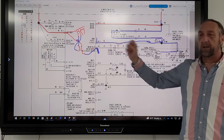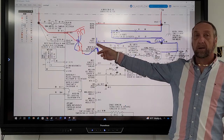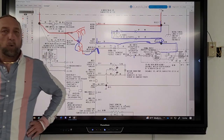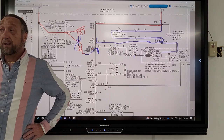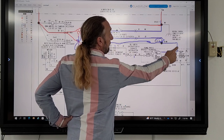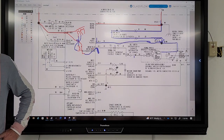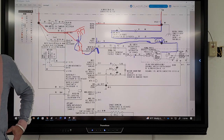No, J4 doesn't need to be connected to the board for that motor to run. Listen, J84 is only there for one reason. Why is that? And I'll go back to this troubleshooting again. Why is that wire J84 even connected to the machine? Because it's really not carrying the neutral back. When the motor comes out, it doesn't care about that. The motor goes this way. Yeah. And it goes through the door switch and goes out. So then that's probably a light to tell you the door is open. It's something to send a signal to the board to say the door is open. Aha.